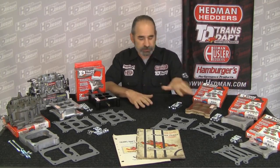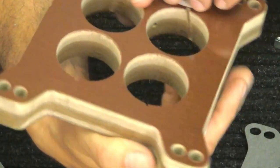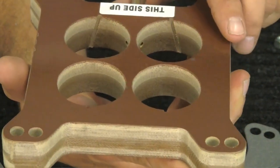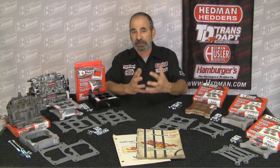This is a slightly different spacer — not a typical carburetor spacer as you know it. It has swirl torque slots in it, and unlike an EFI spacer which is a dry system, carburetors are a wet system, so you have air and fuel going into the intake manifold and into the engine. The droplets of fuel tend to be droplets and not a small vapor, and a vapor burns better, quicker, and more thoroughly. These create a vortex that increases the atomization of the fuel and has been tested and proven to create better fuel combustion efficiency.